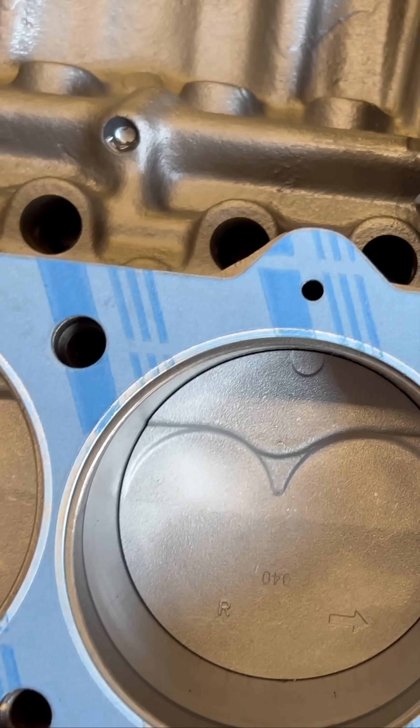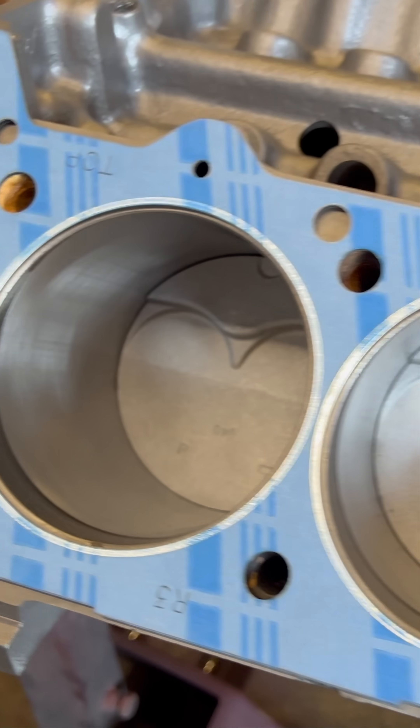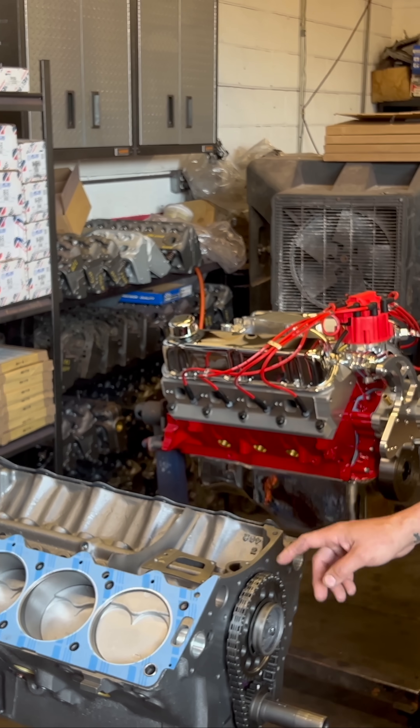So it's not just that you're going in at an angle — you've also got a lip inside. Some engines, like the 348 and 409, actually have a bigger step. That's how they cut them out differently for different combustion chamber sizes on those blocks.